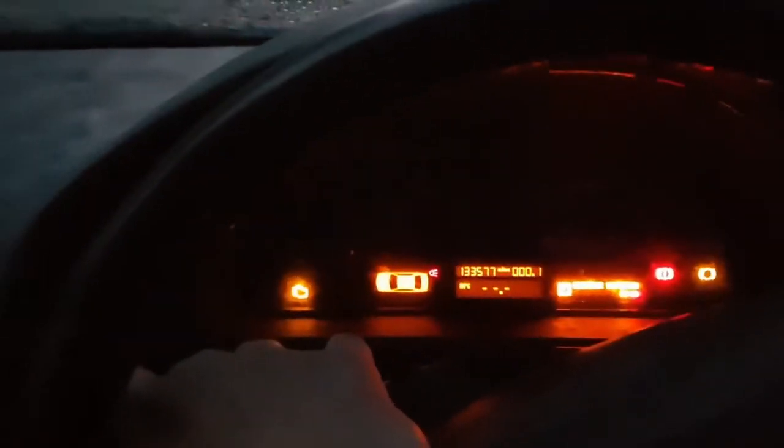When I turn the engine on and use the left hand side indicator, that works as normal. When I use the right hand side, that is blinking twice as fast as the left hand side one. And as you've just seen, on the rear of the car, the light isn't working at all. So there's an issue with the light on the right hand side that isn't just the light bulb that needs to be investigated.